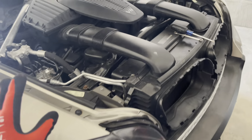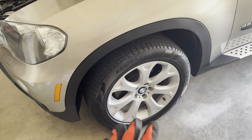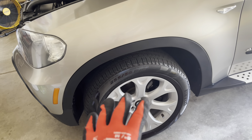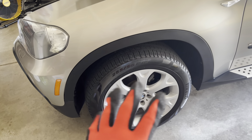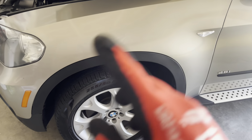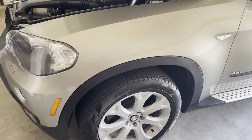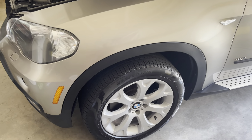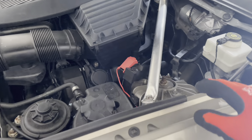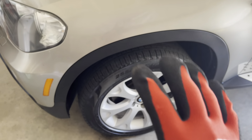Take the wheels off and start PB blasting everything else. My goal for today is to get it in preparation for tomorrow. I am not in a rush - I'm not trying to strip bolts, break bolts, break nuts. This thing is just going to get PB blasted throughout the day and night, probably a dozen times, to do all the bolts and everything I've got to get done.